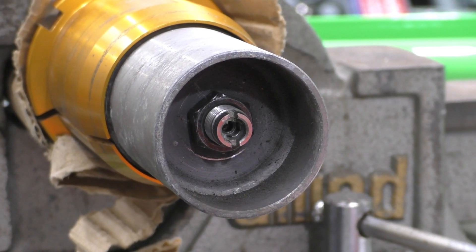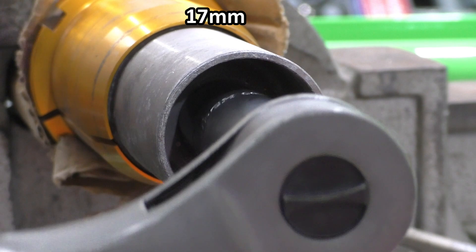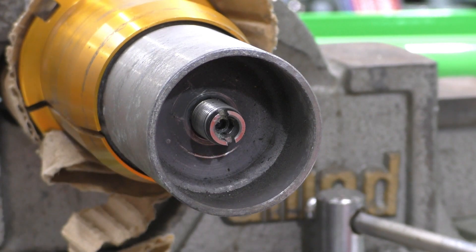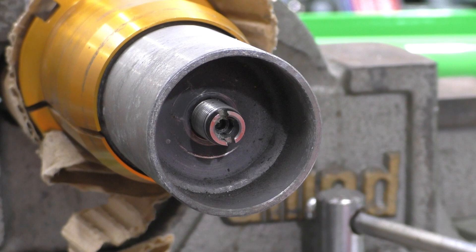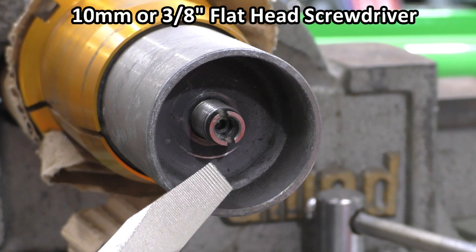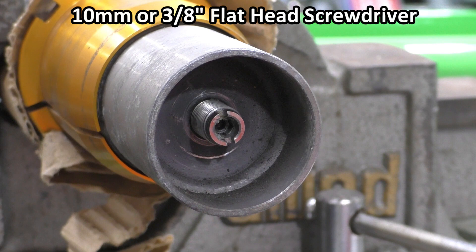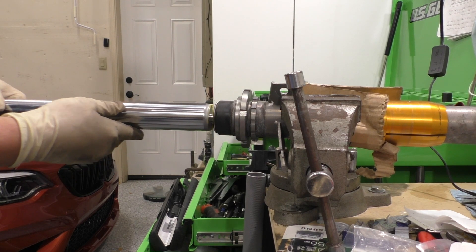Next, you can see there is another nut holding this shaft to the strut body. Once again, that is also a 17mm, so I'm just going to go ahead and unscrew that as well. Once this 17mm jam nut is off, all that's holding the damper piston shaft to the strut itself is the fact that the shaft is threaded into the strut body. So you can take a 3/8 flat head screwdriver or a 10mm metric one and use that to screw this clockwise to push that piston shaft into the damper body. Once the shaft has been screwed in all the way, you can pull the damper assembly out of the strut body.